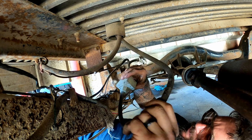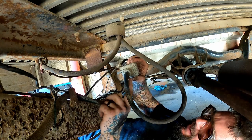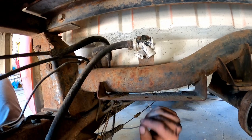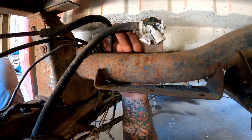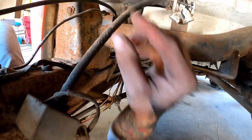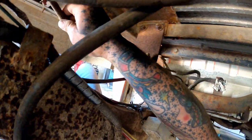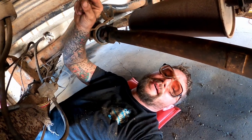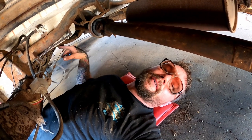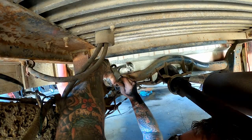If you're curious, here's our fuel pump bouncing around, okay? So it ain't even mounted. So this one's obviously our pickup, and it goes from our fuel pump through this thinga majigger valve, maybe some type of check valve or something, I don't know, and then to our hard line finally. Then our return goes from that hard line to that piece of crap, to this piece of crap, to this piece of crap. And then I'm pretty sure once it gets up there, it goes to that brake line, to then another rubber hose. So what I'm saying is, from the hard line right here underneath the cab to the tank, we're just gonna replace all that baloney.